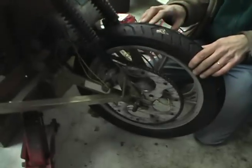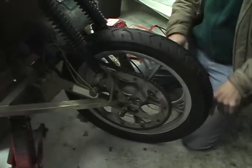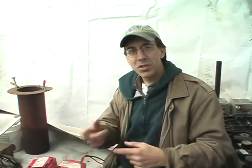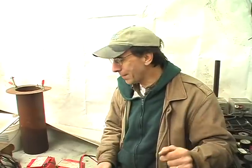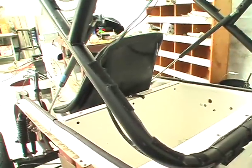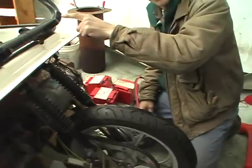Great safety issue: if you ever work on an electric car and you're doing this kind of stuff, always have the electric car drive wheel up in the air. Because I have had the experience where something shorts out, something happens — Murphy's law rules supreme. You have things semi-wired, and all of a sudden this thing takes off across the room. It happened. And it's not cool.